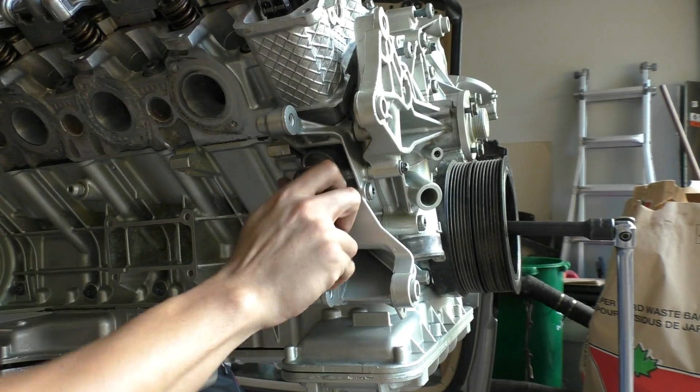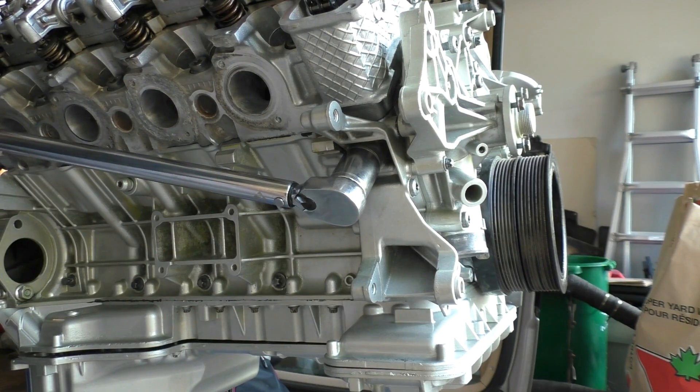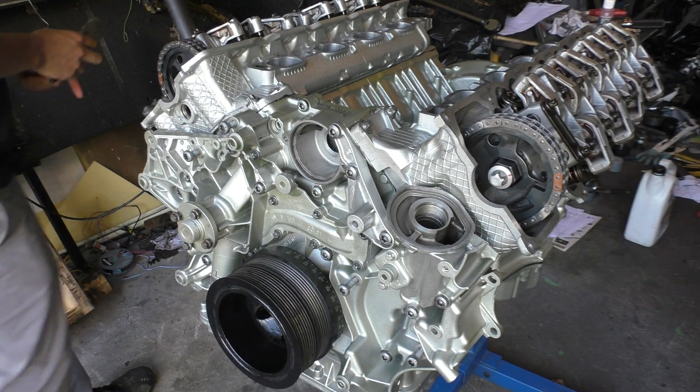Make sure that you can compress it before you put it in, and you need to change the washer — it's a crush washer and you need to change that every time you unbolt this from the engine. The torque specification for this one is 80 newton meters. After all this I cut the wire ties I had applied in the previous video to keep the timing chain from moving.